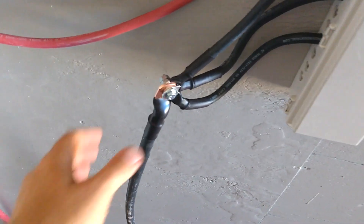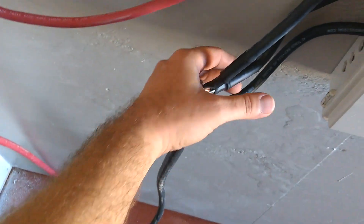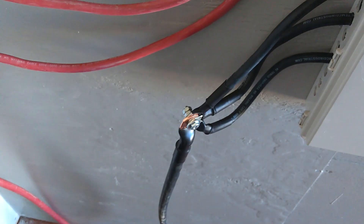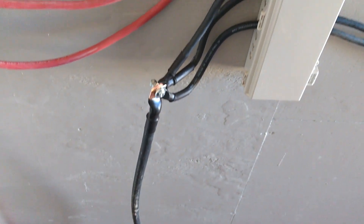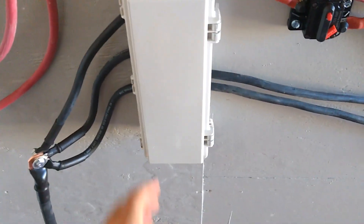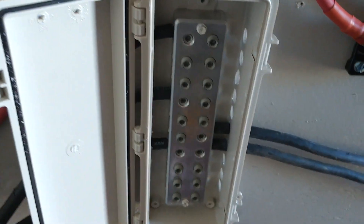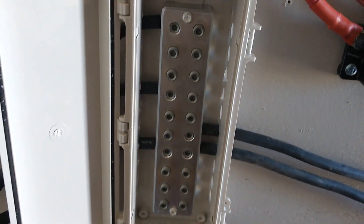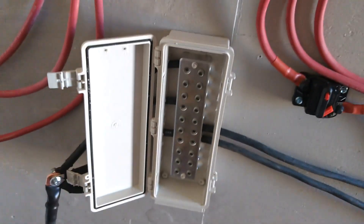This is just our ground coming up from the battery — I'm going to wrap that up with some electrical tape. The whole point is to break it into three 2-gauge wires so that it will fit into our distribution block and also spread the power out so we aren't heating up one part of the block.